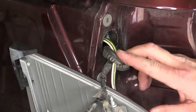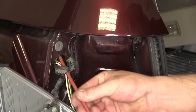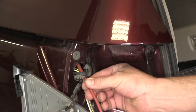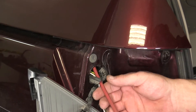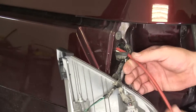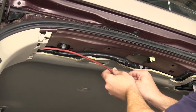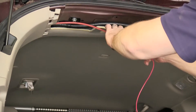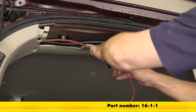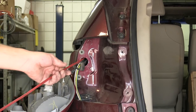Now that we've located it, we'll need to start routing our wire. We're going to use a pull wire — which can be a stiff piece of wire, or in this case a piece of air tubing — to assist in routing the wire behind the paneling. I'll take my pull wire, feed it in through the hole, remove the grommet up behind the headliner, and go ahead and connect our pull wire with our reverse wire that we'll be running. We'll be using some 16 gauge wire; color doesn't really make a difference. Then start pulling it into position.